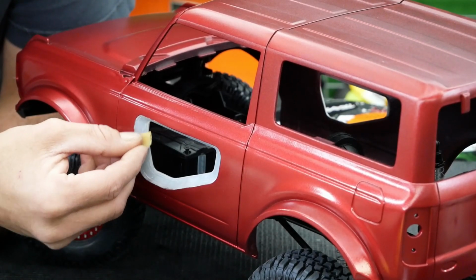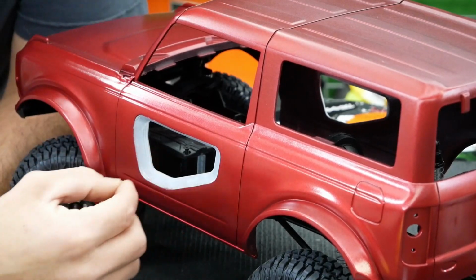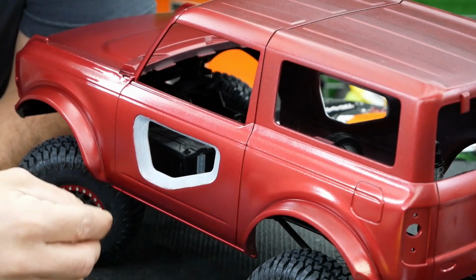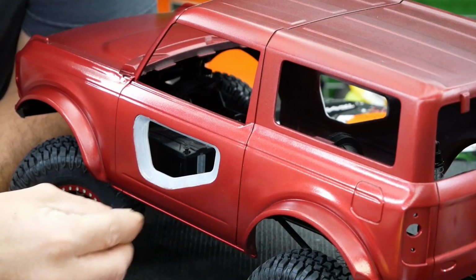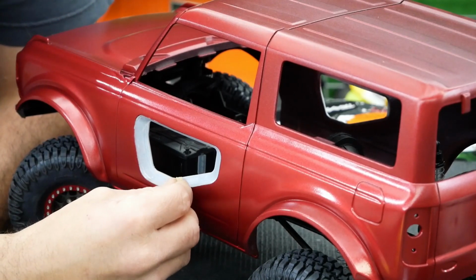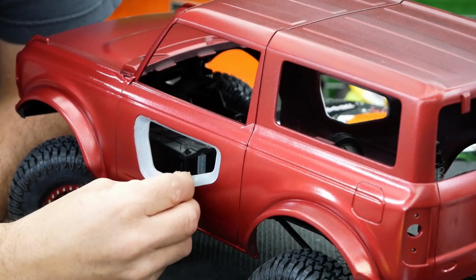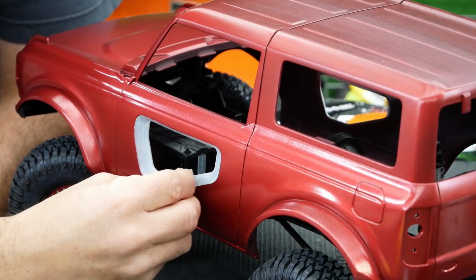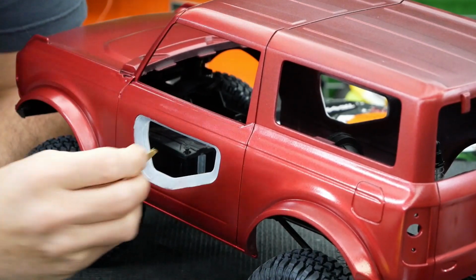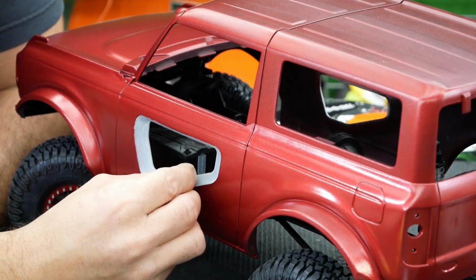You want to make sure you're working in a way where you're pulling back and then pushing in, with a little circular motion, like that. You don't want to go in reverse, pulling down towards the red from the inside, because if you do have a funky edge in there, it will chip. So work your way up in there. Don't actually lift it off, but put the pressure down on the in-stroke if you can. Little tips I've learned so you're not repainting the whole body.